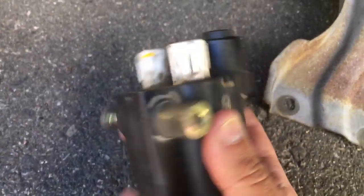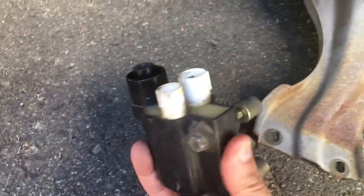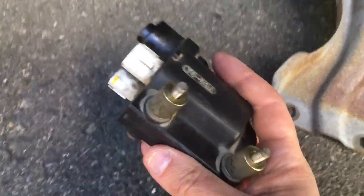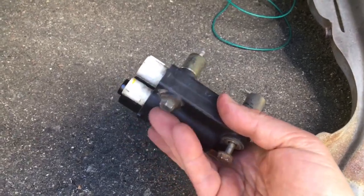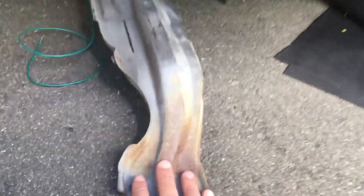The first thing we've got to do is get a signal off of the coil and route that wire up through the car to the dashboard. To do that, you need to get access to the ignition coil. You don't need to remove the coil, but I did to figure out which wire was the signal wire. Be very careful not to damage the coil — they're very expensive. The coil sits directly above the exhaust system and you can't really access it unless you remove the shroud.